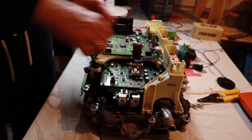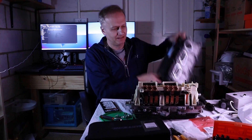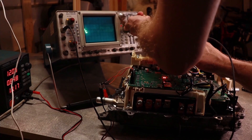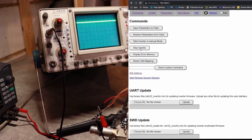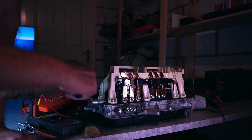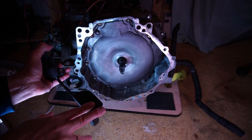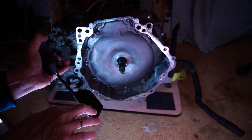I'm Ed, and I'm building an electric car conversion. I've spent a few weeks working on the Toyota Prius inverter and the open inverter board. The challenge I set myself is to build an electric car conversion on a budget, so I was choosing components very carefully. So far I managed to purchase an inverter at a very good price, and I acquired a Toyota Prius gearbox — my electric motor — completed FOC tuning, and got throttle control working as well. I'm ready to start building the batteries and contactors.